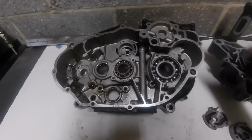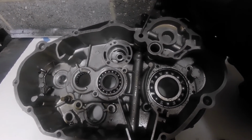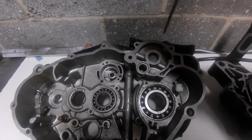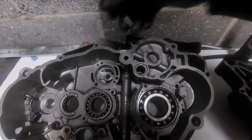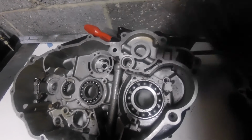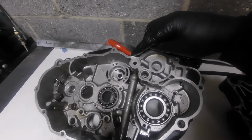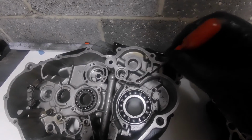That means the outer cover now comes into play. From the outer cover, it bleeds straight across through a little non-return valve in the cover, straight across through the oil filter here, all the way through the paper element filter, through the middle of the oil filter into the centre, and then into here. And then we have a port going up that way, as we can see, just not long enough to come out there. So we've got pressurised filtered oil now in here that can go up that way like the screwdriver, which is to the banjo bolt and out to the cam. And if that was just long enough, it would show it coming into here.